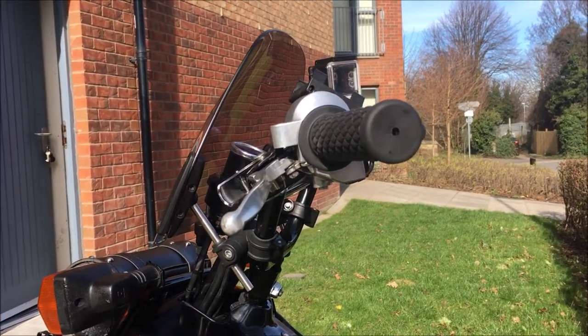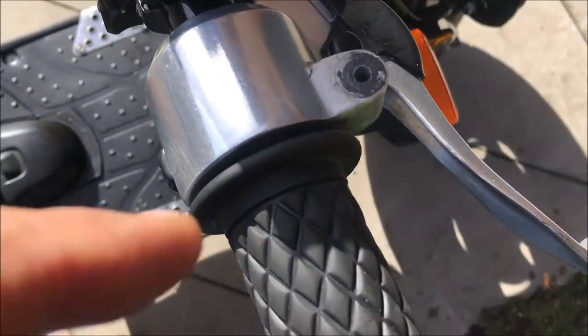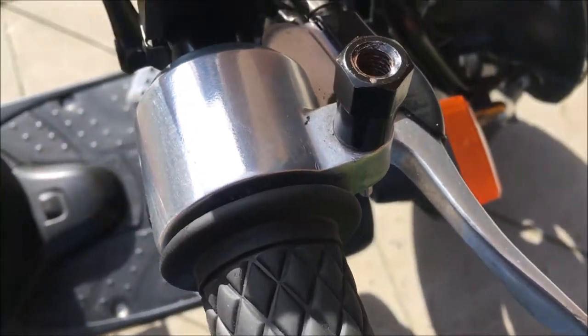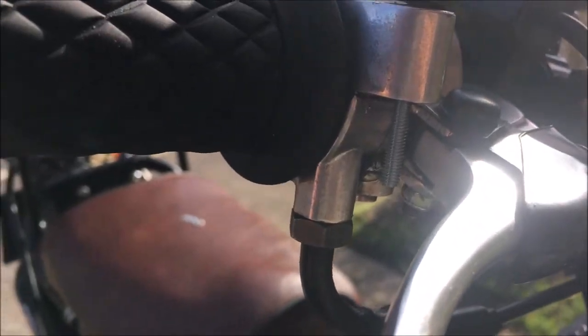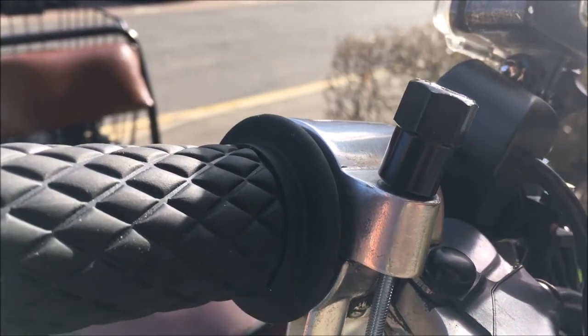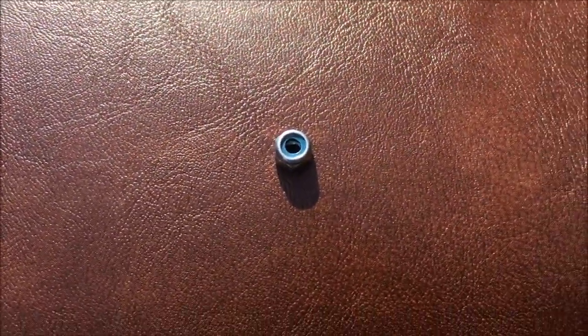Pesky mirrors next. So I've drilled a wee hole through the steel stick, same sort of width as the bolt — just provides a bit more stability. We're going to drop that in, bolt it up through the bottom, and we can hacksaw the excess off. It's not going to interfere with the brake lever anyway. Then the mirror goes in there, and that way we can put the stock mirrors back on with the stripped thread. We'll do the same for the other handlebar, using washers and a little nylon-insert nut for extra grip.